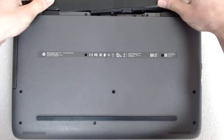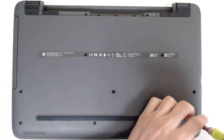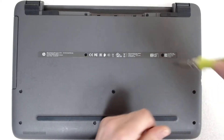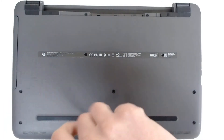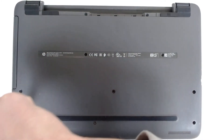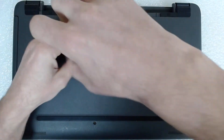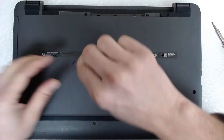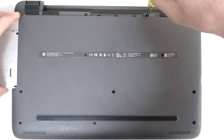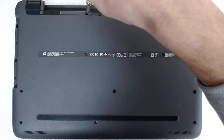So let's start, of course, with removing the battery. We're going to remove all the screws. As much as I remember, on this laptop the whole palm rest with the plastic and the keyboard is coming off, so we'll try now. This is for the optical drive, and after we remove these two screws, I think there are two more hidden under the rubber pads.